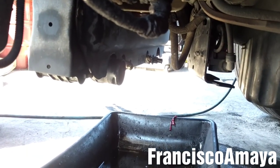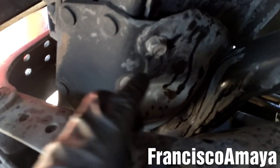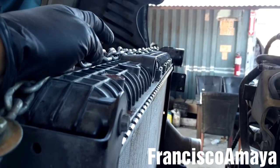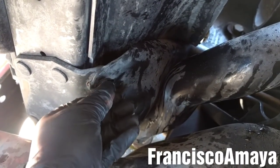All the bottom components of the radiator are completely removed, so the radiator is ready to be removed from the chassis. I'm going to remove the bracket bolts — the two bottom ones, one and two — and remove the two threads on both sides, leaving one temporarily. With the bracket bolts removed, I'm going to place this chain to get the cherry picker in place to hold the radiator. Then I'm going to remove the last two bolts still holding the radiator in place.